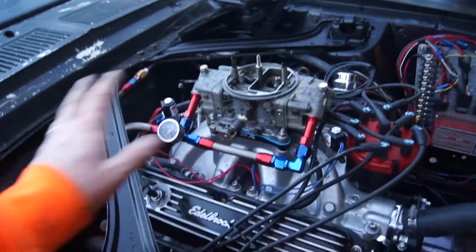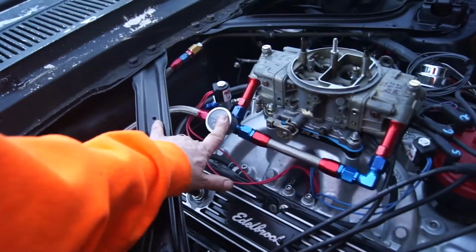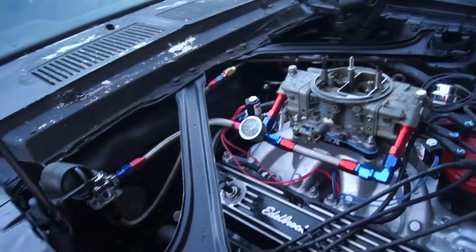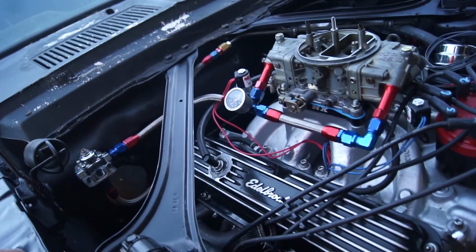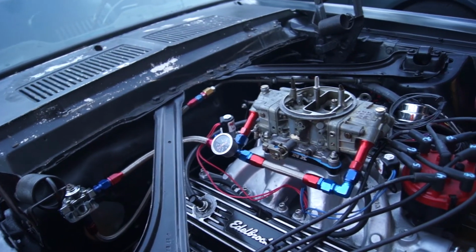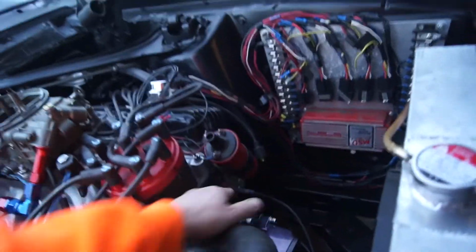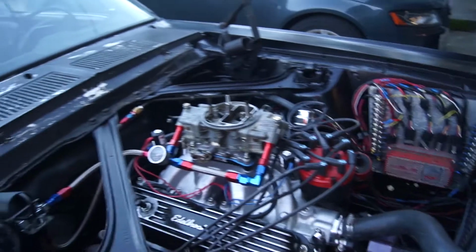Trying to get my fuel system, make sure it's solid. So I mounted a GoPro camera here and went for a ride, and I'm running 7 psi under load, as best load as I can. It's got a little bit of a breaking up issue, starting about 4,000 RPMs. I'm suspecting my coil. It is an older coil, so I might replace that.